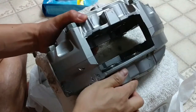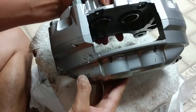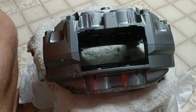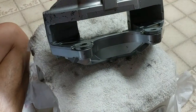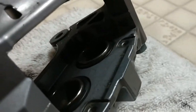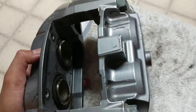This is the Akebono four-piston brake caliper that comes on the Infinitis and the Nissan 370Z. As you can see, they've become quite clean. The first thing you use is the brake cleaner, then soak it inside soap and hot water. Let me show you inside the caliper with a flashlight - take a look, it's quite clean on the inside. That's just using basic soap.